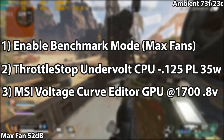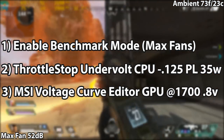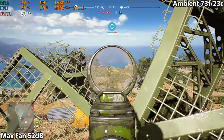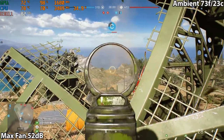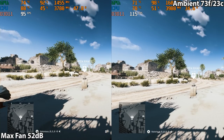Don't forget, every laptop is going to be different. With a very low ceiling for thermal throttle limitations, you'll really have to focus on dialing in the machine on your end. As an example, Apex Legends, while relatively intense, is no Battlefield V. Applying these same settings in Battlefield V shows just how close we are to that 74 to 75 degree threshold. I managed to stay off it for several hours, but a couple of degrees warmer ambient would have triggered frequency throttling. With that tune applied, we get a nice performance bump without compromising thermals on either GPU or CPU.